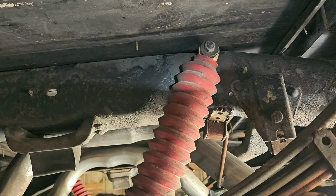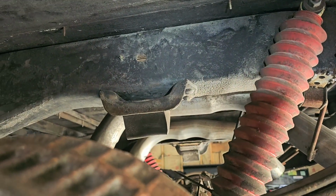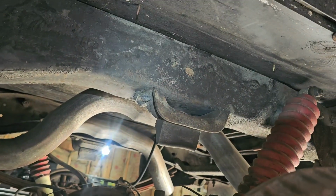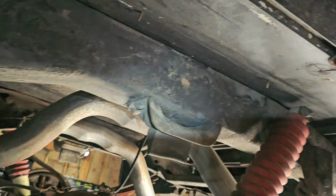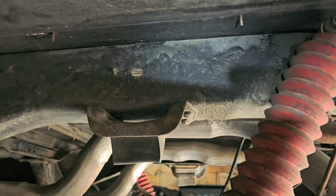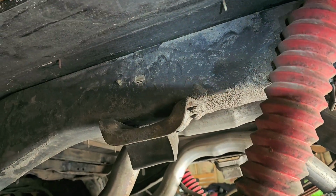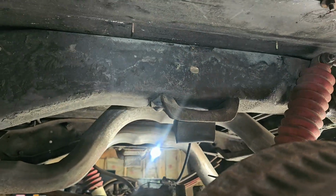I'm going to lift the bed slightly and clean it up good with a die grinder or sander. The plasma cuts really well when it's clean. Just make sure you've scribed it out nicely. Leave yourself roughly 1/8 inch so you have some wiggle room if you make any mistakes. It works the best for me.